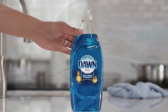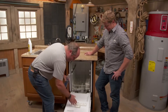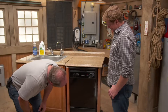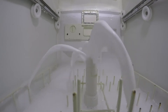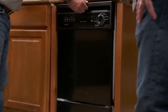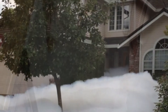From time to time you may want to do a small load of dishes in the sink — that's when you would use dishwashing liquid. Now, we've all asked: if I'm out of dishwasher detergent, can I use regular liquid dish soap in my dishwasher? Substituting regular liquid dish soap for dishwasher detergent is a terrible idea. Ordinary dish soaps are intended to create lots of foamy suds — if you fill the soap container in your dishwasher with ordinary dish liquid, the resulting suds will overflow from the appliance onto the floor. Only detergents specially formulated for dishwashers should be used.